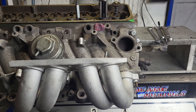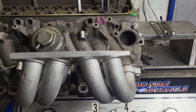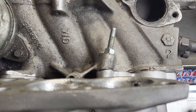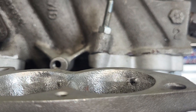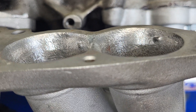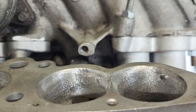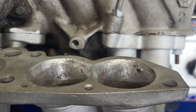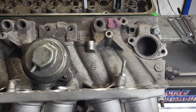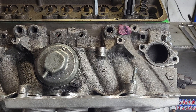We got some airspeeds at the mouth of the runner, and it was bad because I wasn't even able to put a piece of clay on it — there's just not enough metal to hold it. Now these have been modified because my TPI plenum is like an infinity sign; it doesn't have the divider in there anymore. I'll show you that too, but I don't know how much more testing I'm going to do on the plain jane stuff.